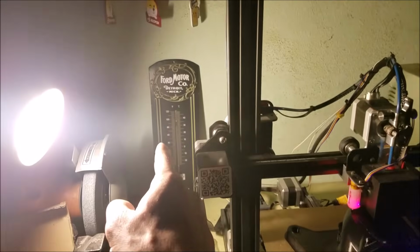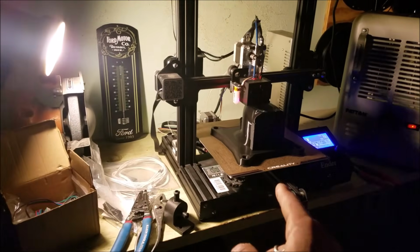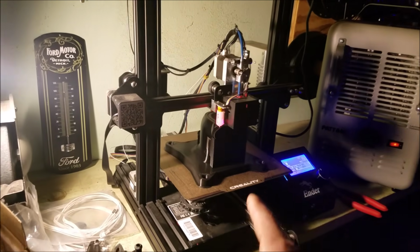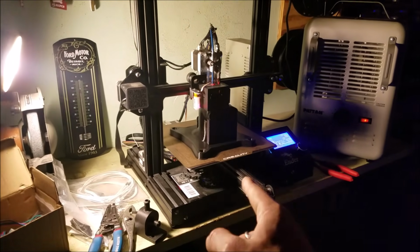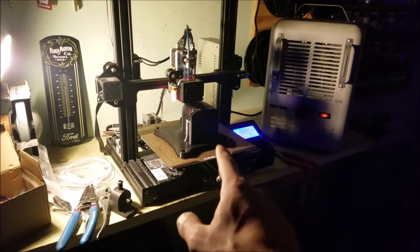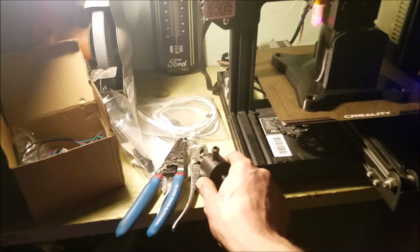And so I broke out this space heater, and it is legitimately 110 degrees in this room right now, but it's holding up good, no warpage, and we're getting there. We're super close. I'm printing this in PETG or PETG, whatever you want to call it. And I've done this stuff before where I've made different adapters and things, and it holds up really well to fuel. Preferably I'd use PETG carbon, which is right here.